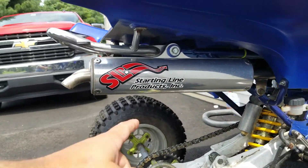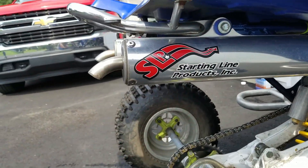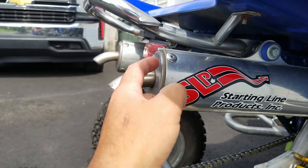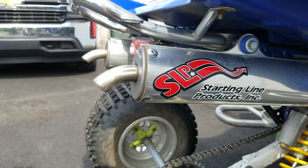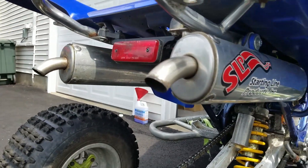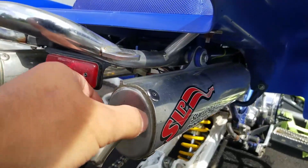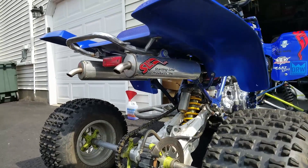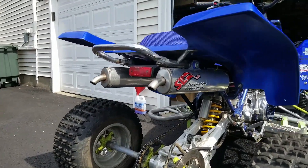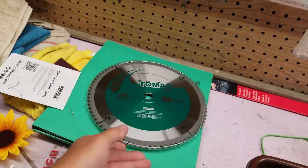So if we chop these down, I'm thinking about making them nice and short — chop them about right here, that's almost half. Then I'm gonna make custom exhaust tips with a bigger opening. I could use these same tips or put my FMF tips in there — I measured them and they're almost the exact same size and shape as the SLP ones. But I kind of like things to have a unique look, so I'm probably gonna make custom tips. Changing the diameter of the tip will actually change the tone of the exhaust — I've experimented with that on other machines, never on a two-stroke. I'm gonna be using this aluminum chop saw blade — that should cut through the aluminum no problem.